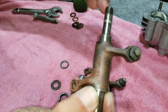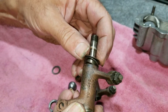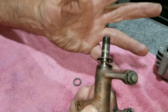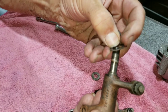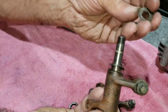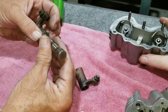To get it the original factory way — 1970 and earlier — this went in up against the shoulder. This is a 1970-and-earlier part number, and they kept constructing them the same way because they didn't realize there was a difference. What we have to do is discard this, get another one of these, put this on first, then assemble it into the case. This one gets eliminated because it has the wrong washer. We'll clean these up and go over it again when we put it back together.